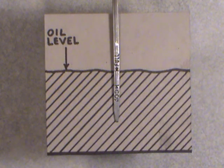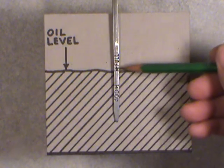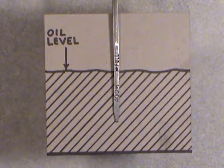So get your gas and do whatever you have to do first. Get your snacks, use the washroom facilities, and come back and check your oil. Give it a chance to drain back into the oil pan so that you can actually see the level on your dipstick as to how much oil is actually in the engine that sits in that oil pan.